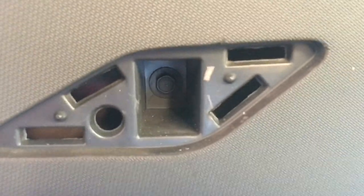In order to get the seat belt out, you're going to have to take off the whole plastic cover. First, pull the panel right where the driver's seat belt is — it just clips right off. For the side covers, it helps to have a pocket screwdriver; just go in on one side, careful not to damage it, and it just pops right out. In there is a 7mm bolt you'll need to remove.